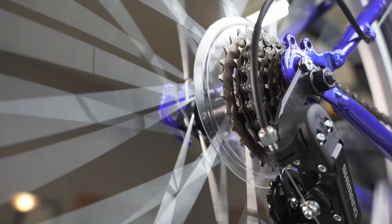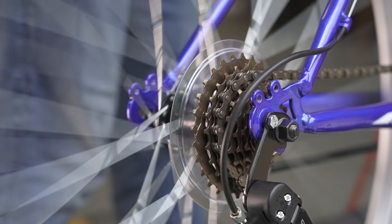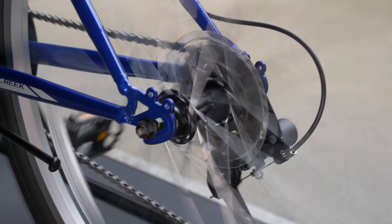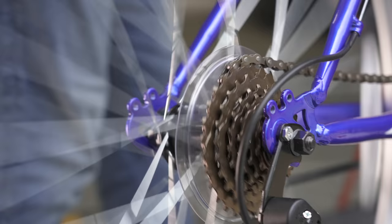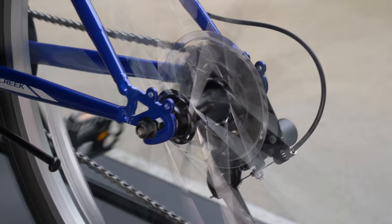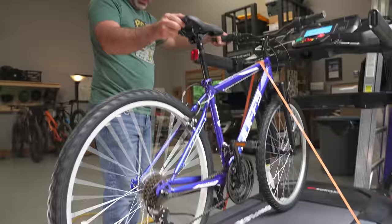This is the test with the dork disc. I'm going to show you what happens if you shift into that gear while the bike is moving — both wheels on the ground, forward momentum. You're rolling down the trail — shift. No problem. The chain shifted off, went behind the dork disc, got wrapped up a little bit, but basically slid by. The bike kept rolling. It didn't lock up the rear wheel or rip the rear derailleur off.